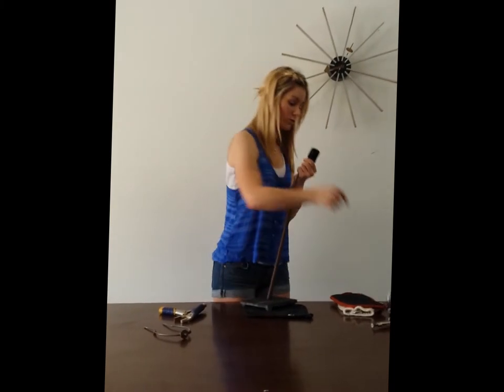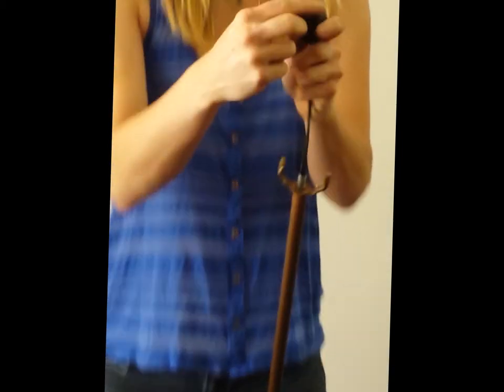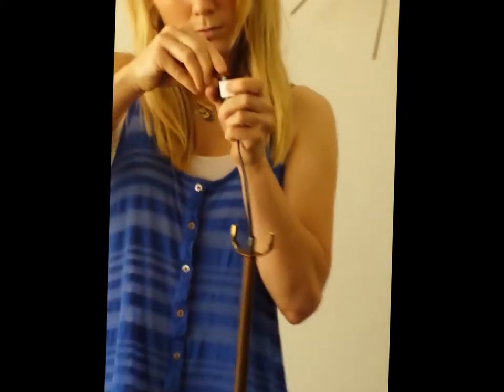This part is where it gets a little hairy. I know you were wondering why I brought the tweezers. So in the inside of this, there's a little mechanism when you try to turn the lamp cage — I don't know if that's what it's really called, but that's what I'm going to call it. There's a little golden piece that keeps it from turning off, which is probably for safety. So I just stick my little tweezers in and I'm going to pull it back — this is not going to affect the lamp, it'll still work, I promise. The inside of this little lamp piece — it's the piece on the very bottom right there — it's gold, and it's shaped kind of like an L. You have to pry that little L piece up so that you can turn this guy off.